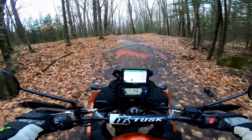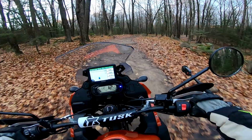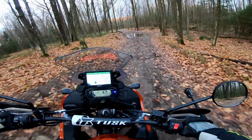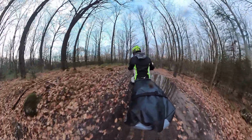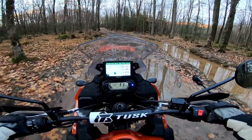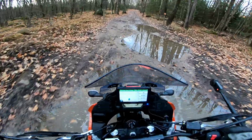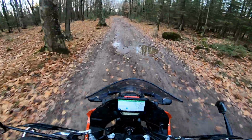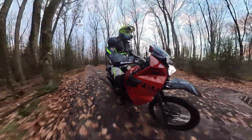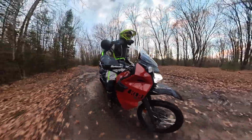I do kind of wonder if I was on a Gen 2 right now without the Thermobob, what that temperature gauge would be reading. I think it only really climbed up to like halfway before it would open the thermostat and dump a bunch of cold coolant right on the piston. Well, not on the piston, around the piston. But I would bet that it was probably right around this temperature, more or less. And I definitely had the cooling fan kick on that bike a couple times while riding through some kind of slow, hairy stuff. And so on the top end, slow moving stuff, I really doubt that you're running the bike any warmer. But if you guys have more knowledge on that than I do, please feel free to let me know down in the comment box below.